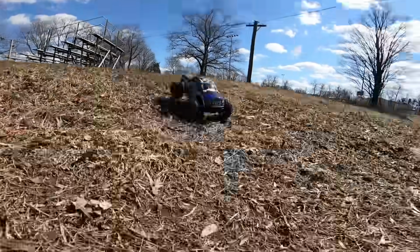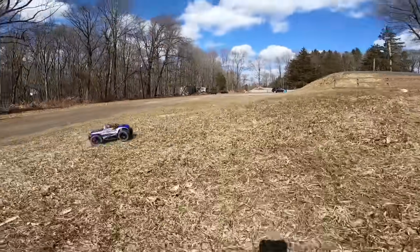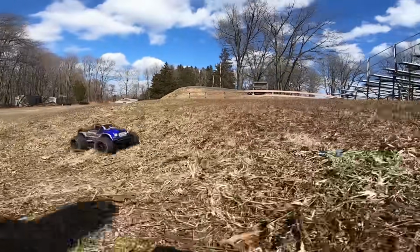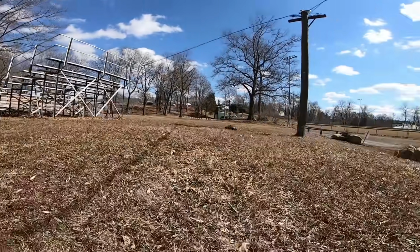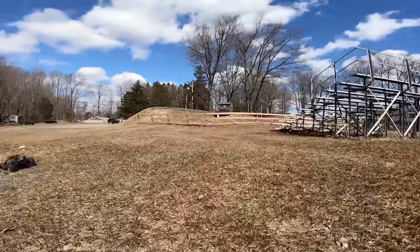So the downside of that is you could possibly bend a dog bone, and what I'm noticing here is some more slop in the hubs and in the steering knuckles out front, because I think basically it's just getting slammed and kind of causing things to wear a little bit there. So I want to point that out to you guys, that there's a little design issue there.